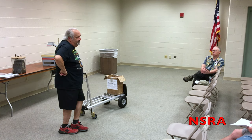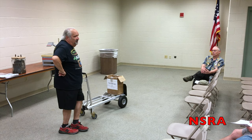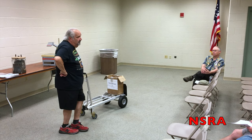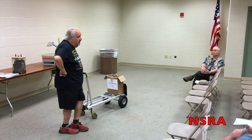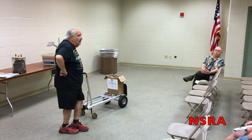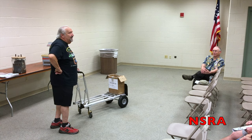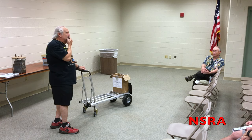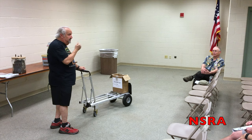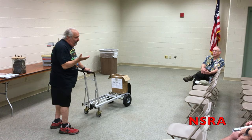As soon as you go to 8 volts, you've got to change things. And then you've got to worry that your light bulbs are made for 6 volts. If you're going to tour, and I like to tour, you wouldn't want to run 8 volts on a bunch of 6 volt light bulbs for a long time. They're going to burn out. So you're changing light bulbs a lot more than you used to. You go touring with a 6 volt car? Oh, I've done it. I'm a pretty crazy, stupid person, but I like it. About 8 years ago, I bought a '54 Bel Air at Hershey. I drove it back to California. On 6 volt. It is a 6 volt car, it's a '54.